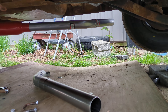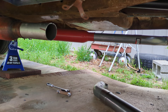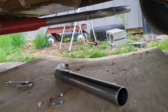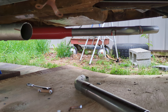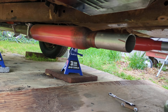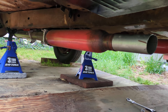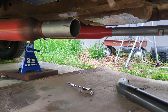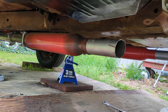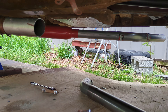The last thing I'm working on right here is a rudimentary exhaust. That pipe on the right side goes out just before the tire, and I've got to cut this side down and put this piece up there so it goes out right before the tire too. This is a semi-temporary exhaust — I'm going to run this until I can afford to take it to a shop and have them do a proper exhaust. The problem is it's an X-frame car and the exhaust runs under the frame without much clearance. The factory ran the exhaust looped under and parallel to the outside of the frame, so the exhaust and muffler were at about the same level as the frame itself.